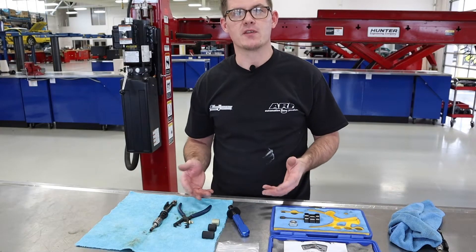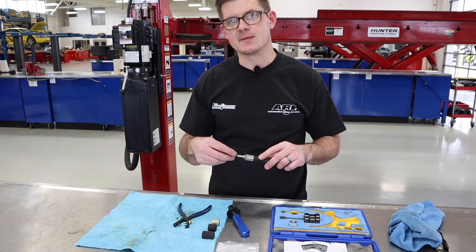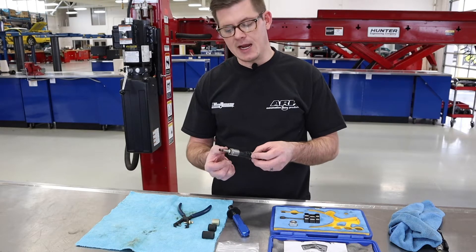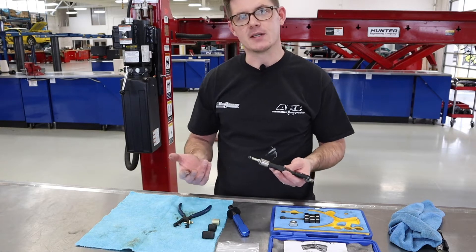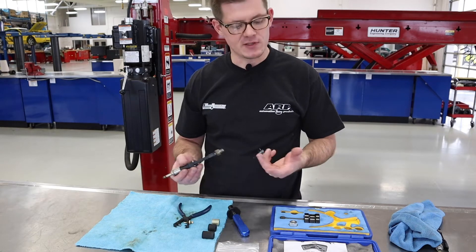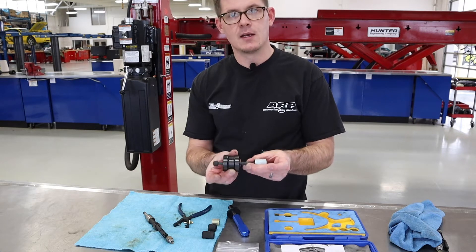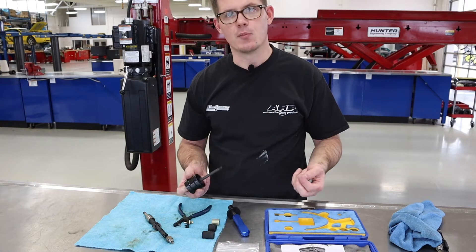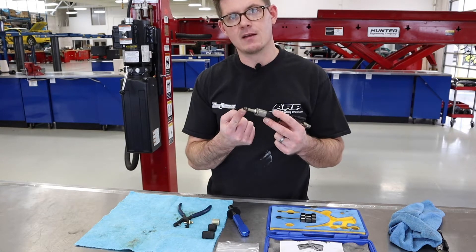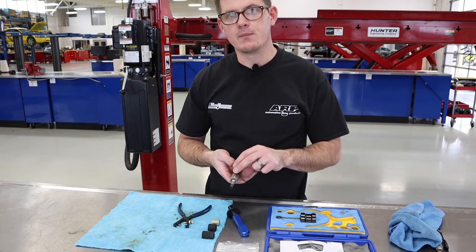The process is really that I need to cut off this Teflon seal. It's pressed on and fitted to the injector — it's a very specific diameter, and they are not reusable. So if I take this injector out of the engine, I've got to replace this seal and this decoupler. A lot of these BMW platforms have a small specialty tool that goes on the fuel pipe end threads and acts as a small slide hammer to pull the injector out. They're not terribly difficult to remove, but there is some resistance because of the tight tolerance at this Teflon seal end, which has to seal combustion and withstand high temperatures.